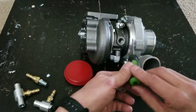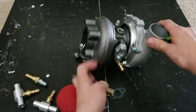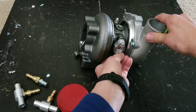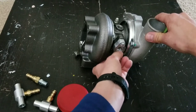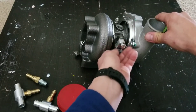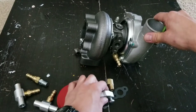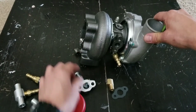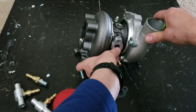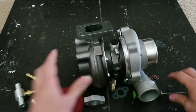This thread I think is metric — it's very close. At the bottom for the oil discharge it's metric 8 by 1.25 — call it simply M8. You have to customize a small item here: I threaded it half-inch MPT in the middle so I can apply the discharge fitting and you're good to go. It's a little flange — I made it with my best abilities — half-inch MPT thread goes in nice and easy.